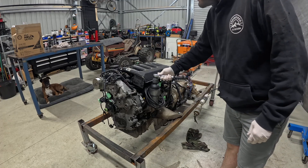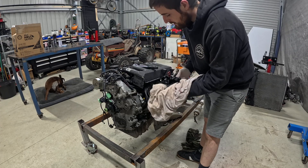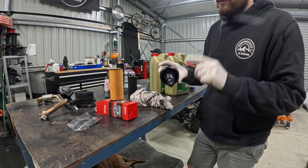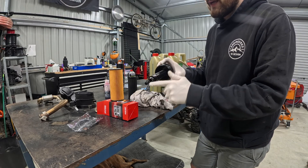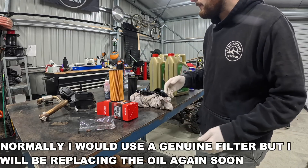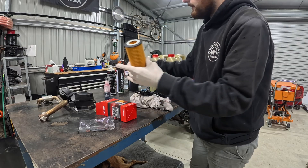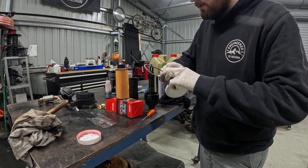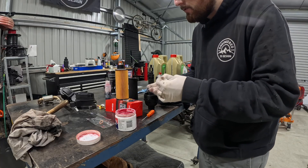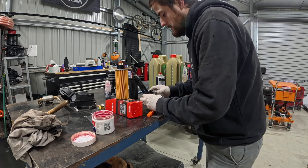32mm socket — we'll loosen this up. So this is what's called a cartridge type filter, it's not your conventional type where you've got a metal housing — it just uses the filter inside this whole housing instead. There are a couple of o-rings: one on the top here, one down near the end, and one at the actual end. Now with the Ryko filter it does come with those and a sump plug washer, which is pretty good for the price — I think it's like 25 bucks. We just need to make sure our numbers on the bottom both line up, and they certainly do — both in height and diameter. Rubber grease — a tiny bit on these o-rings. This will help prevent that plastic housing from snapping too once it gets 10,000 k's old and grabs like no tomorrow and you can't get it off. Now we can put our filter in.